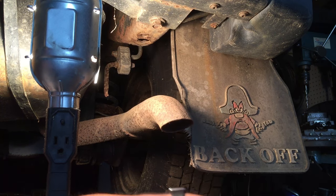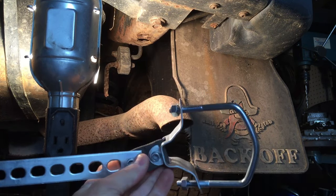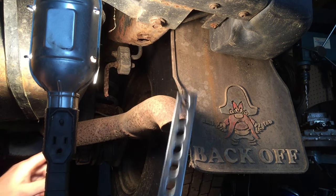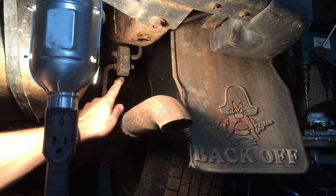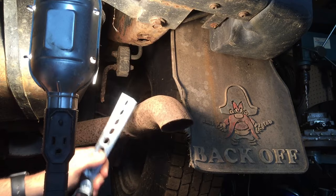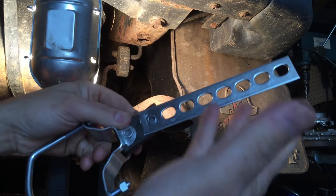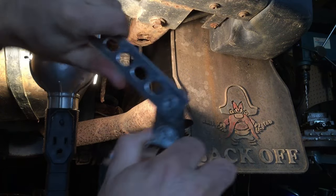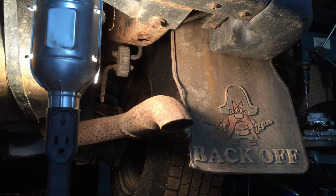It's very simple. You get the part that goes around your pipe and then a part that gives you several options to bolt it through something. What we're gonna end up doing is pulling this piece out and bolting it up into this spot here. We'll end up twisting it around and clamping it to the muffler. You might have to bend it or even cut off a piece — it's a universal system. It does have a swivel so you can adjust as needed.